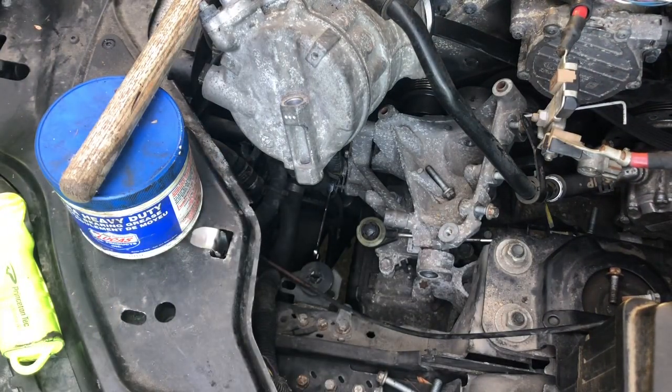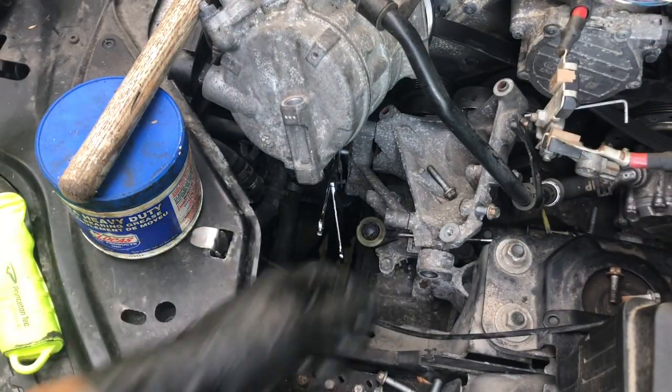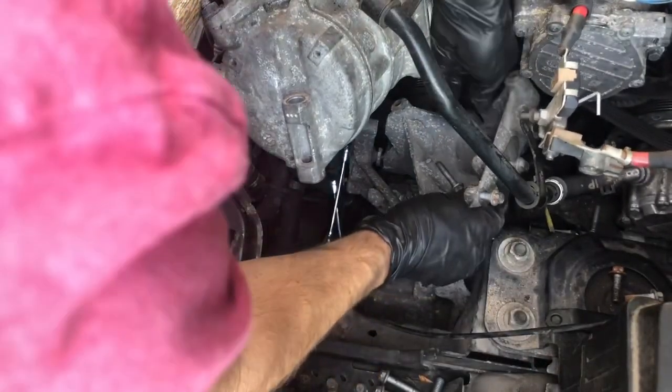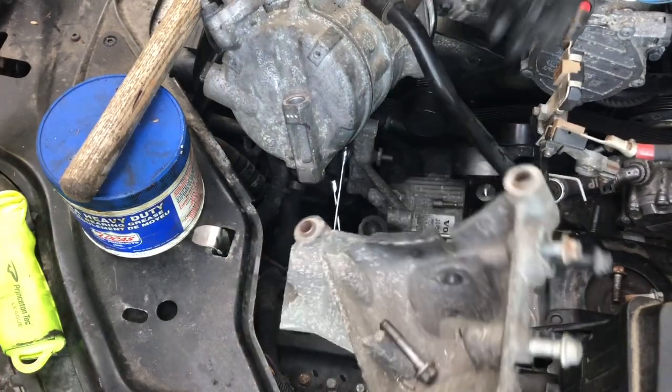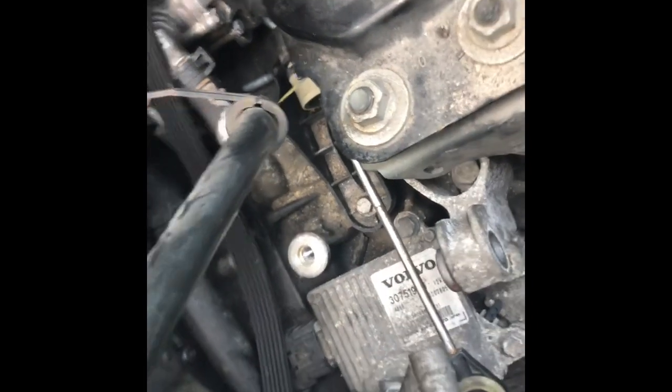So that's out. I'm going to use my 10mm wrench in behind to see if I can gain access to that last bolt. That's out too. I'm going to leave both ratcheting wrenches in there. There's my 7mm thread. One thing to mention — there is an oddly shaped adjustment washer that belongs on the bottom, do not lose that, and you'll understand why when I go to reinstall.